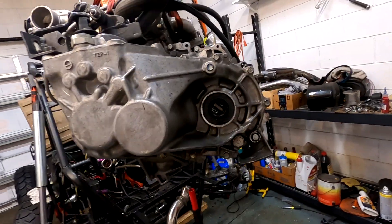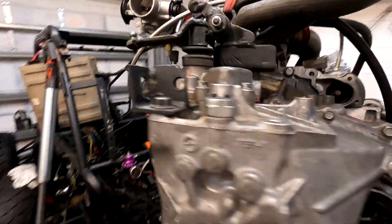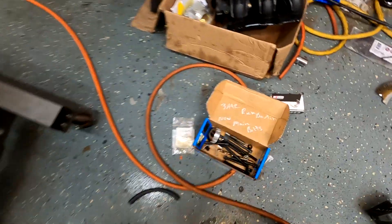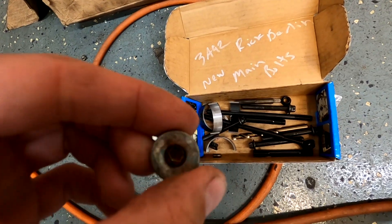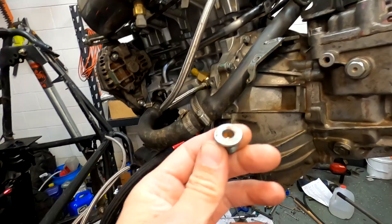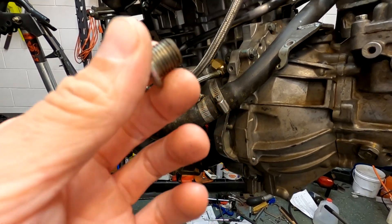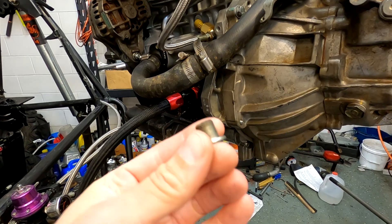Morning update - today is now Sunday. Working really late again last night and as far as I can tell, it's holding pressure the next day. If you guys follow me on Instagram you probably will have seen a post about this already. The engine just came out for now the third time, and this was after it was completely filled with fluids - I've got transmission fluid all over my floor. The reason this thing was removed again is because I have this spare freeze plug that I found in one of the boxes. The machine shop that assembled the bottom end put the crank in and did the clearances - they are the ones that took three of these plugs out. I located two other locations for them and put them back together, but this third plug was in a very tricky location and it never got reinstalled back into the engine.